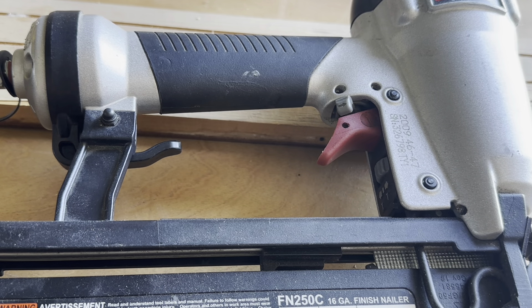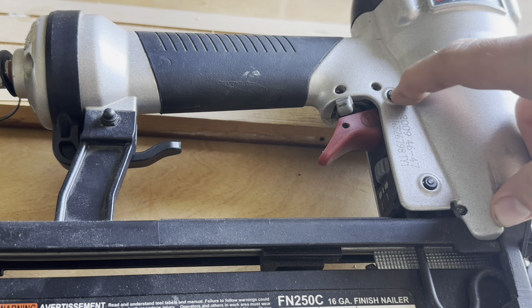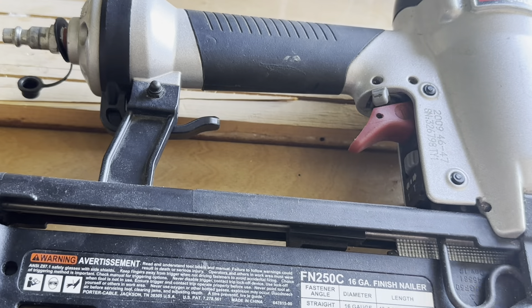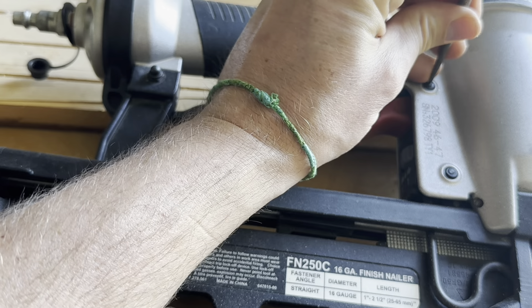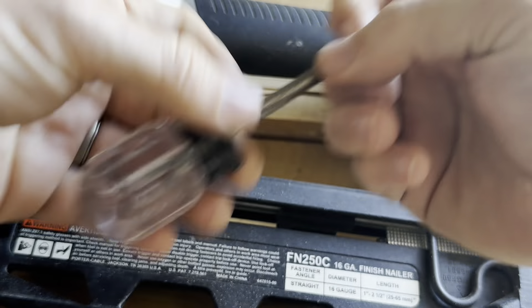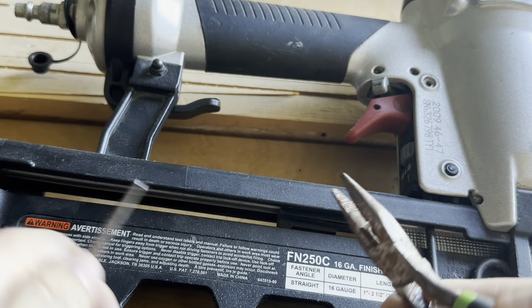Now we got this guy here. This is like a little cap that goes on there. You want to make sure you're on the side with the cap — the other side is nice and smooth. As you can see, it's nice and smooth on one side; this side has a little dimple on it. We're just going to take our awl, center it on there, and give it a good pop. That came right off. We want to keep that little retainer clip. If it gets stuck on there like mine just did, just take a pair of pliers and pop it.